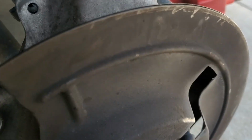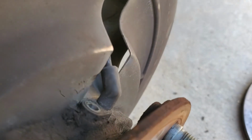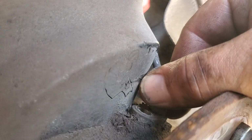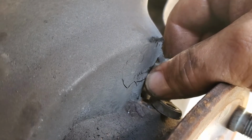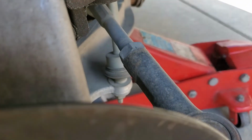So, this is a grease zerk. Right. What I did last time was pulled the wheel speed sensor out of the hub and just shoved a grease zerk on the end of my thing and did it that way. I'm wondering, those threads look pretty similar. So if the threads are similar, the size is similar, it's similar. We're going to screw a grease zerk in there and go that way.